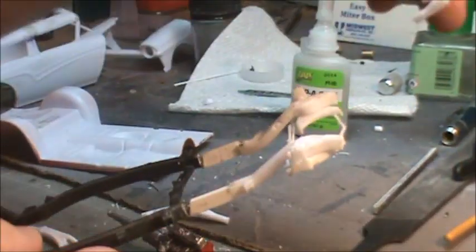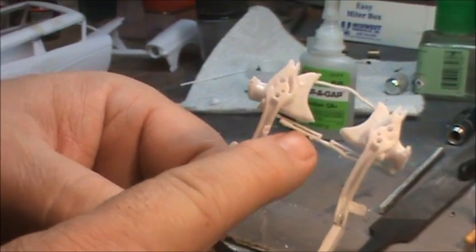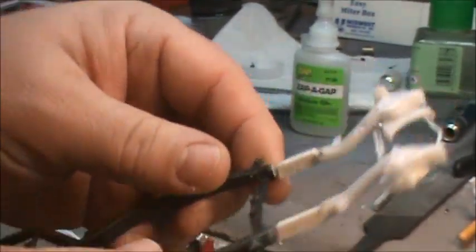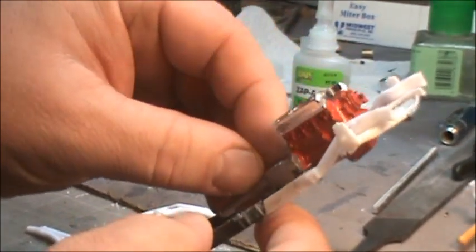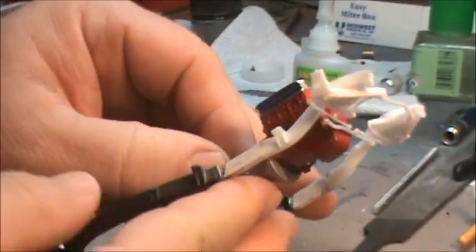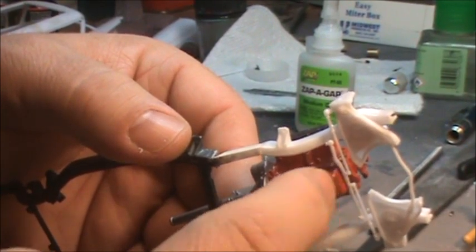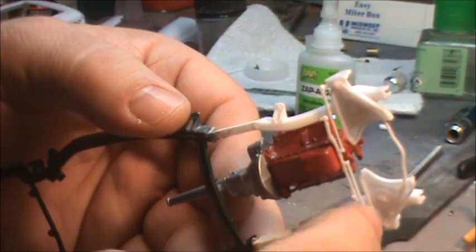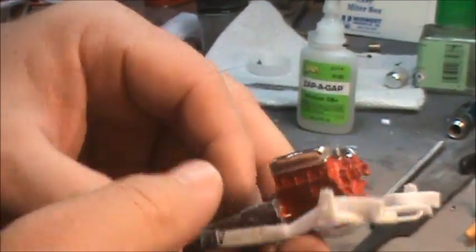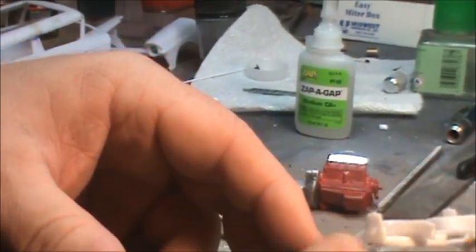I also cut off the very tip of the frame here - this part is gone. The pinion gear and steering mechanisms I had to remove because when I put the engine in, it has a specific mounting point for the transmission and lays forward, so these steering linkages were up against the oil pan. I removed the steering linkage from the control arms and just shortened them just a touch, put them back in place, and that gave me just the room I needed for the engine with clearance.